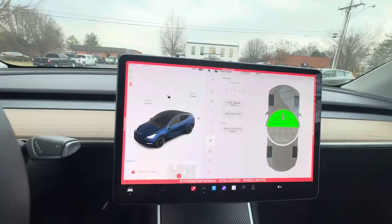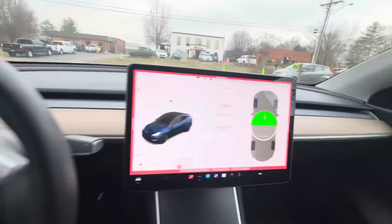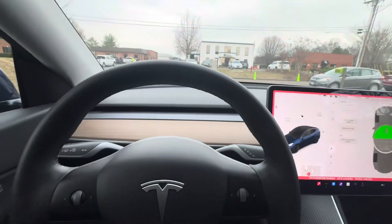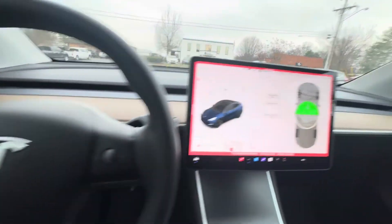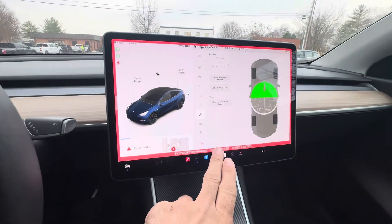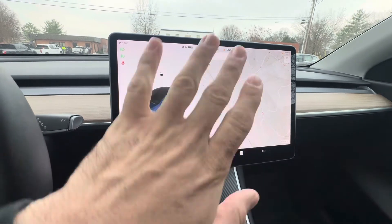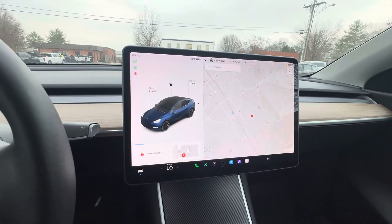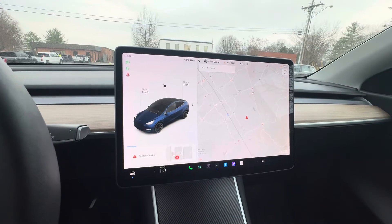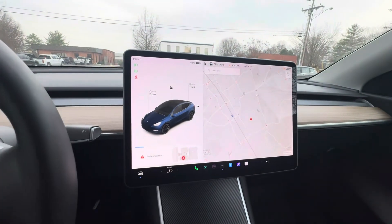So to get out of this, once you get it all done — and again, you have to keep it in service mode, someone holding the wheel, keeping an eye on the gauge while the person underneath is adjusting the toe, because that's all you're going to have. And then once that is done, you don't do anything else up here. You're going to hold on to the button and it's going to exit out of service mode. Since I've already done the zero offset, we don't need to do it again. But you do need to get into service mode to hold the wheel.